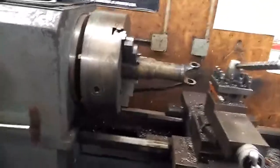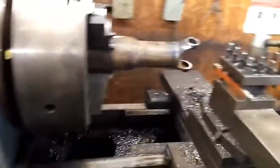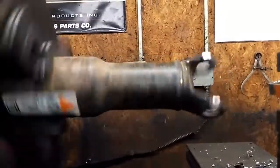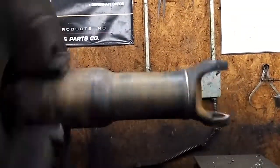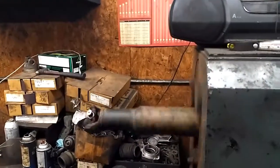Well, whenever you spend that $150 and you get down here to me, I'll take the U-joints out, get the slip yoke off of it, figure out what I ought to do. I'll put it over here in this cutoff lathe, hit the button and stand back and watch it. And as you can see, that's just about as crooked as can be. Look at that thing right there jumping like a bass out of water.